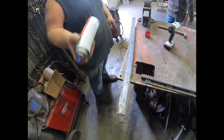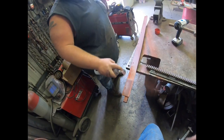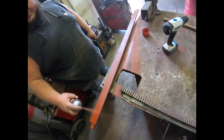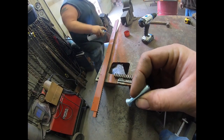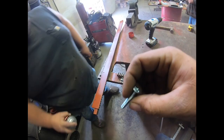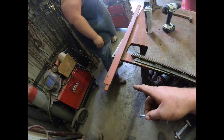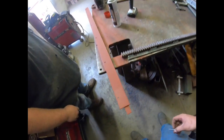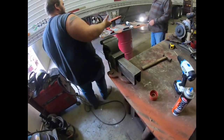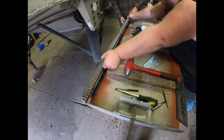We walked around the shop with it and brought it back to the welding table so we could feel like we were on one of them hot rod TV shows where they say 'send it off to paint.' Now dad strength's back with it, he's painting it right back where we built it. These are the bolts we're going to be using to put it back on — being that the huck rivets had a countersunk head on them, these are the closest thing we could find that would fit back in that countersunk hole. Quarter-inch hole, quarter-inch bolt — everything works good.